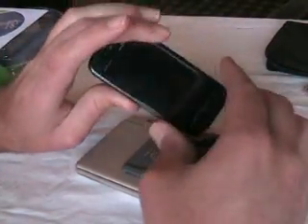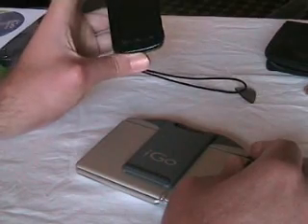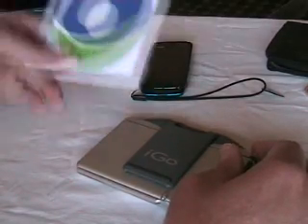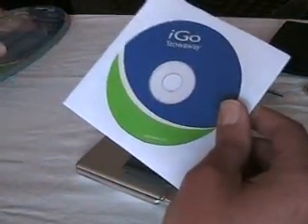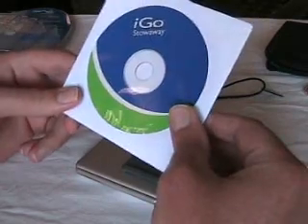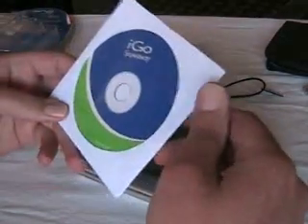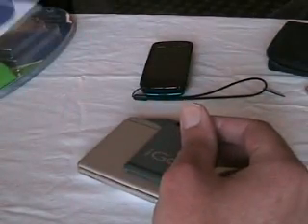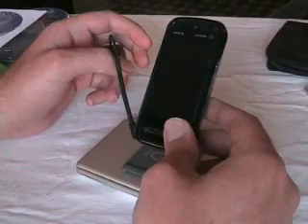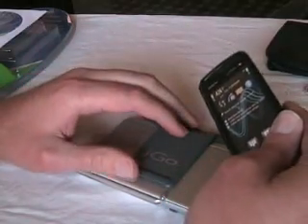First of all, you need to get the software for the Nokia 5800. As this is a discontinued product, you will need to download the software from the internet because the software CD that came with the package is for S60 version 2 Nokia phones, such as the 6680 or the 6630. I recommend getting the S60 version 3 software from the internet, which is not actually for the 5800 — it's for phones like the 6110 Navigator or 6120. But it is the latest and that's all that is available, seeing as it's a discontinued product.